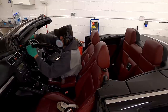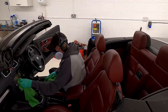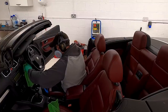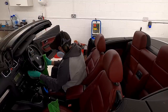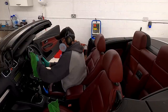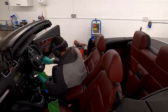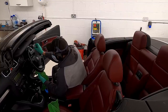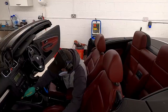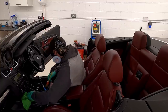Once that's done we can switch to an interior cleaner - I'm using Bilt Hamber Surface HD, a really good product. I'm spraying it on the cloth and then rubbing over things that are a little bit more delicate, like the stereo - I wouldn't want to spray water directly on that as it could damage it. Also the wiper stalks which had loads of makeup on them: put a bit on the cloth and just rub it over and it removes all the dirt. Having an air compressor is also a great tool in the workshop because you can use it to blow any dust or bits of dirt out of crevices where two plastic trims might join together, or awkward areas you just can't get a brush into. It's also really good at getting in between the seats to blast dirt out to an area where you can get the vacuum cleaner in more easily.